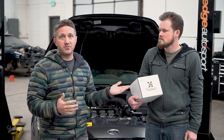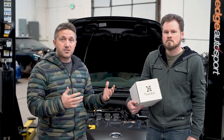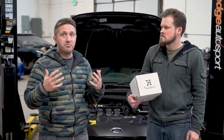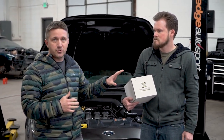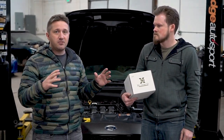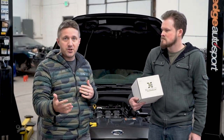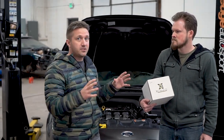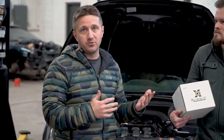We're not going to lie — this is not an inexpensive upgrade. It's pretty pricey. It's high tech, it's hard to make, so it does cost a lot of money. However, the practicality and the benefit of it is totally worth every dime. This is all controlled through the factory ECU tuned with the Cobb access port, so there's no adding of extra tuning systems, no extra calibration going on. This is all basically tuning the factory fuel system just with higher flow — much more practical and can easily get you to your goals without complexity.